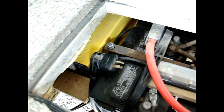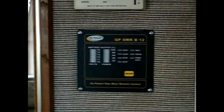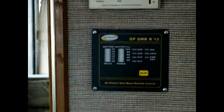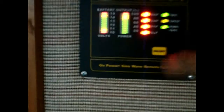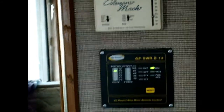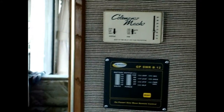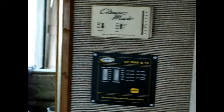When I want power, I simply plug that cord into one of the 110 outlets, plug the other end to the outside of the coach, and come in here and turn on the inverter from the remote. I just flip it on and we're ready to go. Just remember to turn it off and unplug the 110 cord — I usually do it from the inverter since I don't have to go outside.